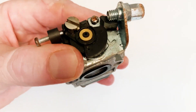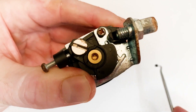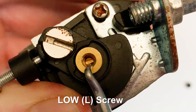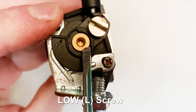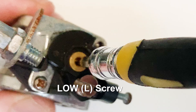So with this in mind, enter the tiny hidden screw here at the top. This is indeed the adjuster screw that adjusts the air-fuel mix at low or idling speed, otherwise known as the L screw or low screw. This screw is not as accessible as the high screw — this was most probably to prevent the over-usage of this screw.